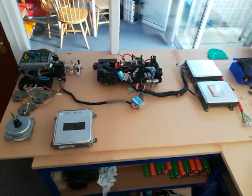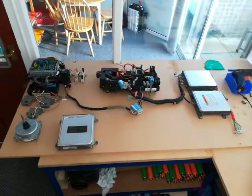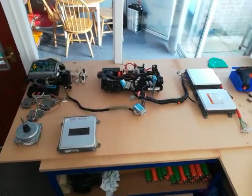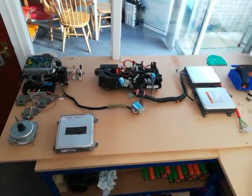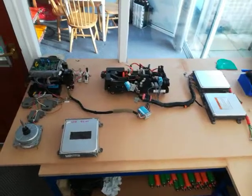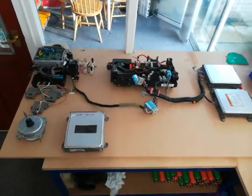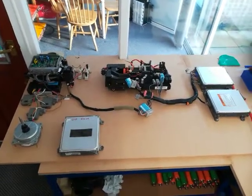What you can see here is the first draft layout of my complete IMA system on the bench. To do more research and work on the failing voltage control modules and possibly quick failures, we need to get a working IMA on the bench. This is an evolution of my earlier BCM, MCM and OEM display setup on the bench, which some of you may remember from years ago.